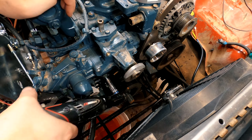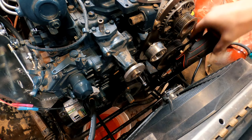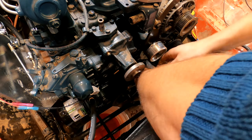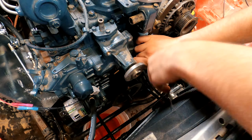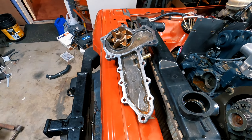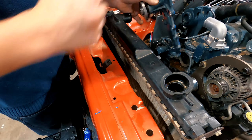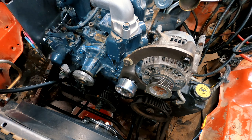It goes by too quickly on time-lapse, but this is where I discovered that a lot of the bolts on the left-hand side of the water pump were very loose — I could actually unscrew them with just my fingers. I did consider just tightening the bolts and putting everything back together, but I decided the best idea was to take everything apart and add blue Permatex to the gasket to create a better seal. There is a thin gasket on the water pump, but it wasn't ripped and actually looked okay, so I just put Permatex over it before reinstalling it onto the engine block.